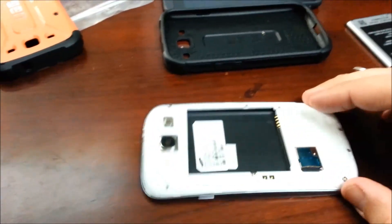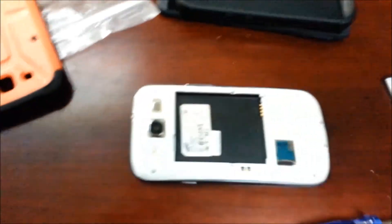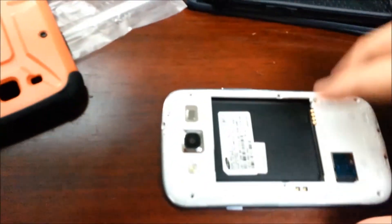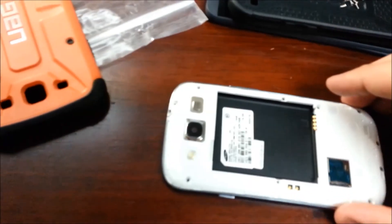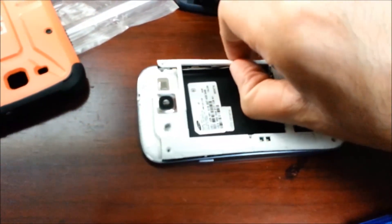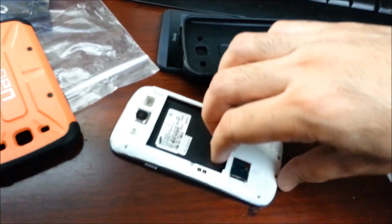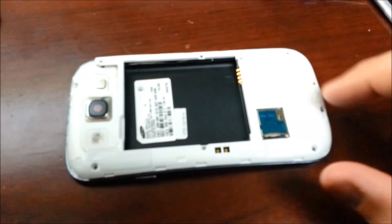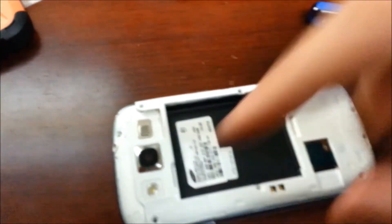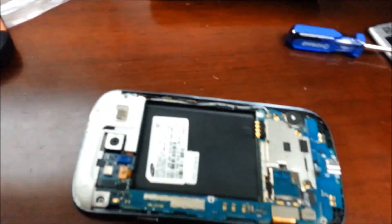You might notice this portion has changed — I was using a different handset for demonstrations. But finally got all of them out, as you can see. Also remove the memory card and get that out of the way. Gently pull this portion and you can see the back just separates really easily, so just be careful and be patient — don't rush and end up breaking something. Those 2 screws come off too, so you're going to take all 10 screws out total.